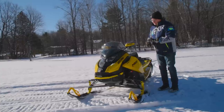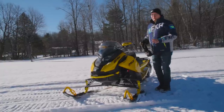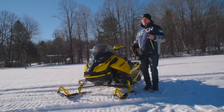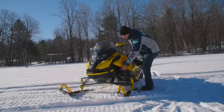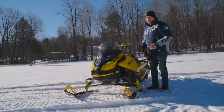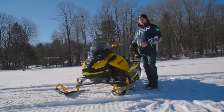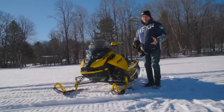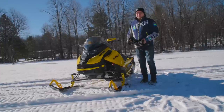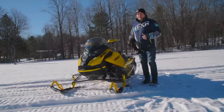The KYB EA3 shocks deserve explanation — these are KYB's answer to Fox QS3s, and everybody knows how much we like QS3s. Let's get over the 16 or 21 clicks we've lived with for the last 15 years. There are three settings: full soft, medium, full hard. See how easy that is? You don't need 16 or 21 settings — trust me, nobody does unless you're on a racetrack. This gives you a great range of adjustability, and there's a significant tangible difference as you go through the clicks, unlike a 16-clicker where one click is imperceptible.